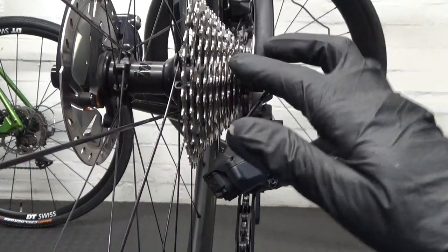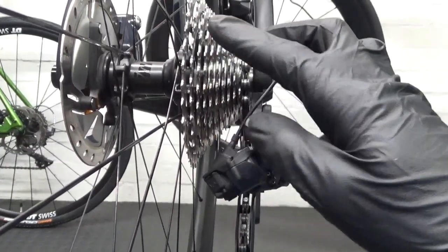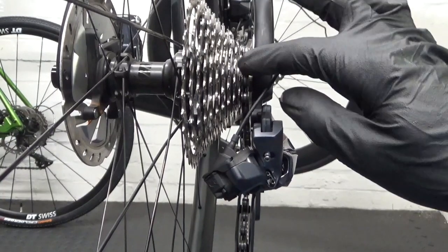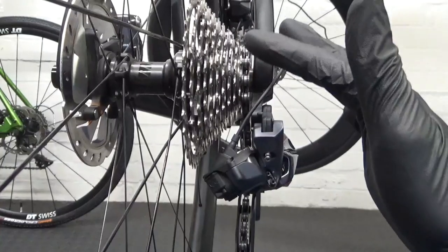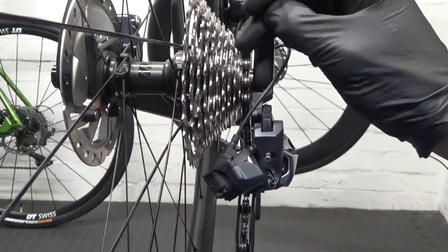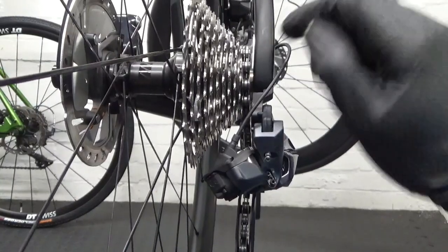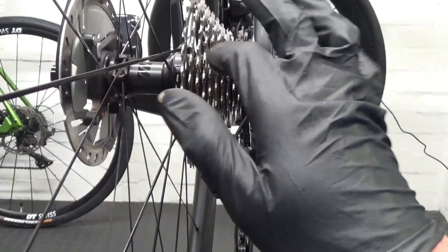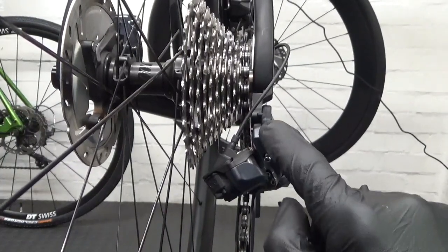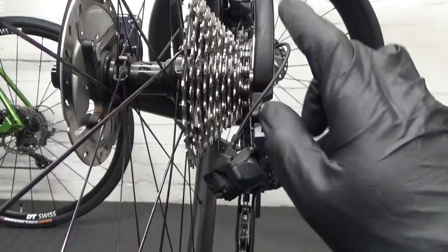As you can see, we've got all the gears going up to the largest sprocket and then all the way back down. They're all working as they should. Note that the front chain ring is now on the largest at the front — as you come down to the smaller sprockets at the rear you'd be cross-chaining too much otherwise. Run through the gears a couple of times to make sure they're okay.